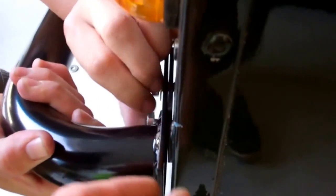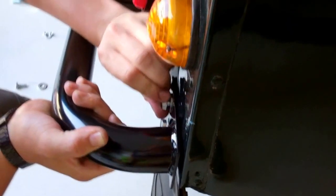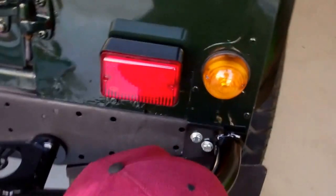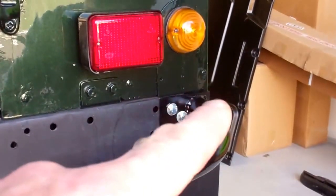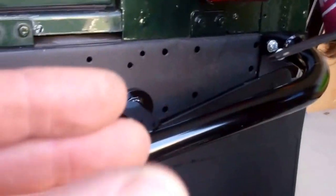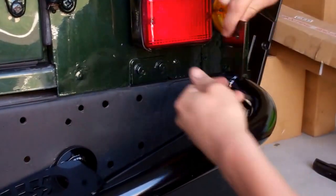There's a little spacer bracket, because otherwise it doesn't clear — we didn't want it touching the bodywork. When you bolt it up we wanted a little gap so that any knock transfers the force onto the rear cross member rather than onto the aluminium bodywork at the corner. We could put a little neoprene gasket in there if people think it's a problem — let us know and we'll cut some on the laser. That way you won't have a gap but it won't push on the body. These plates can go either way around; they're both identical, not left or right — not handed.